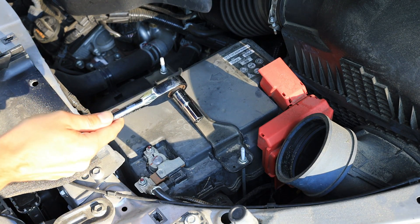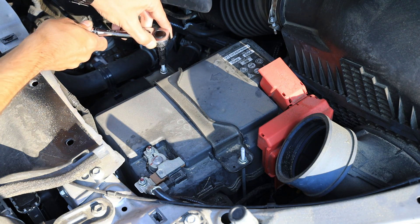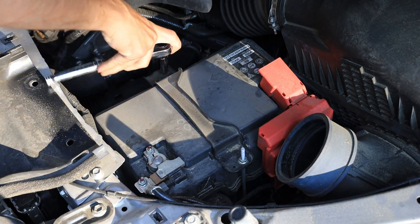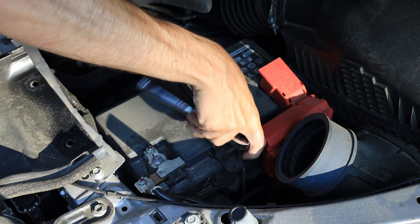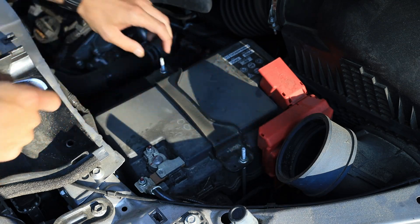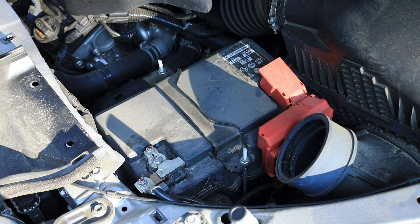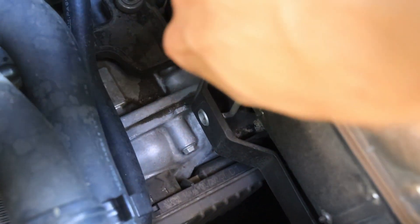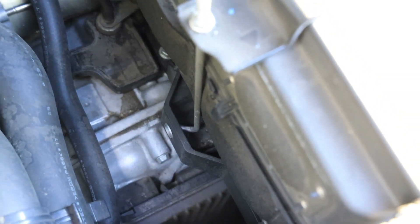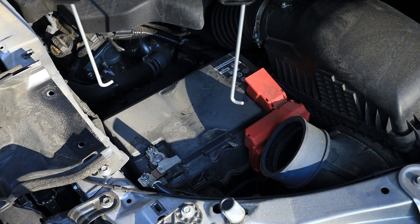You're going to just need a 10 millimeter socket to get this battery hanger. It's going to require a deep dish socket to get it done. So we're going to first loosen this up. Once these are loose, you're not going to have to loosen them all the way — just enough to get the hangers down below out of the holes. The bar going down has to fit into the little hole, and once you loosen it up enough, you can just pop it right on out. Same on the other side. Once you get this out of the way, you do the same thing on both sides and it lifts right out.